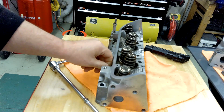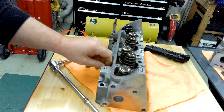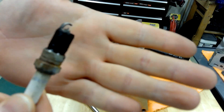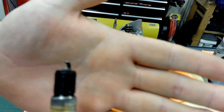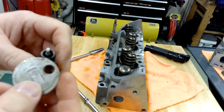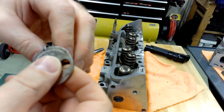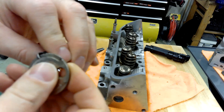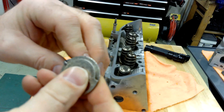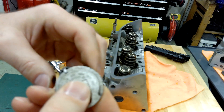It's been a crazy fall cleanup for me. Okay, there's the spark plug. It's got some cleaner on it so don't worry. The ignition part looks okay. We're going to gap it and see what it was — stick it in this little tool, run it around until it's tight. These were like 64 thou, not 60.